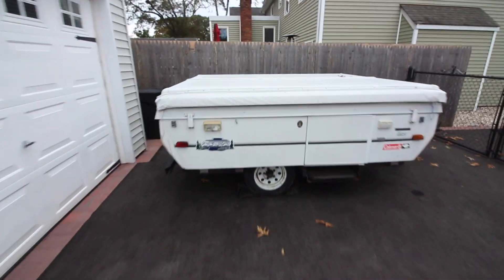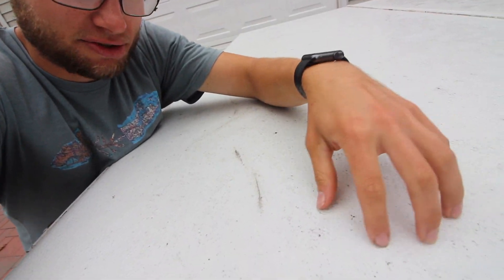The surface of this roof is already kind of a textured material — I think that's actually the aluminum sheeting itself. The original white paint is starting to just flake off; when I wash it with a hard enough brush the paint comes right off and all the runoff turns white. The other unfortunate part is that the little thin pieces of aluminum covering the roof structure can start to form pinholes, which allows water in, and for these pop-ups water in the roof is a complete killer.